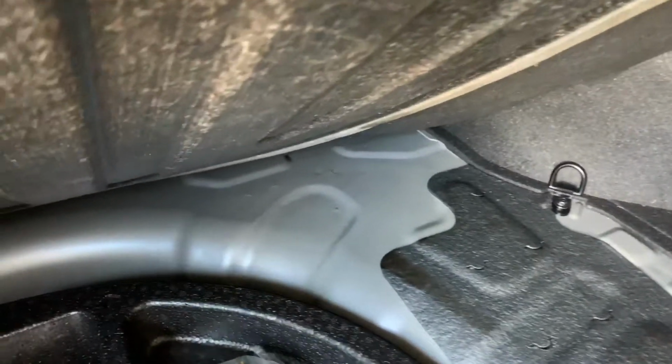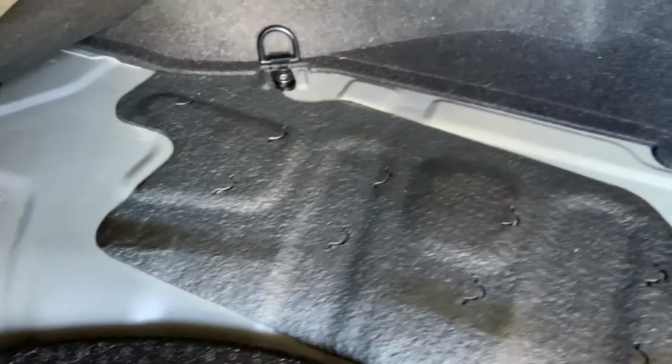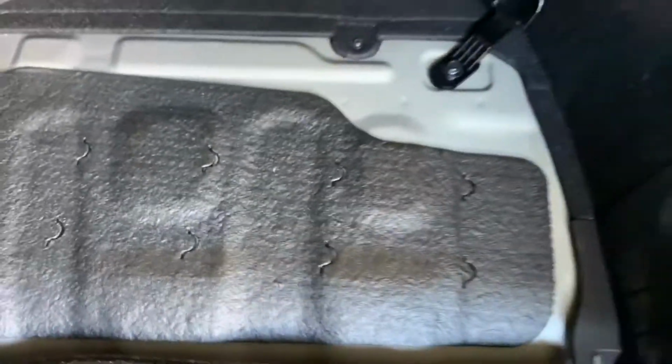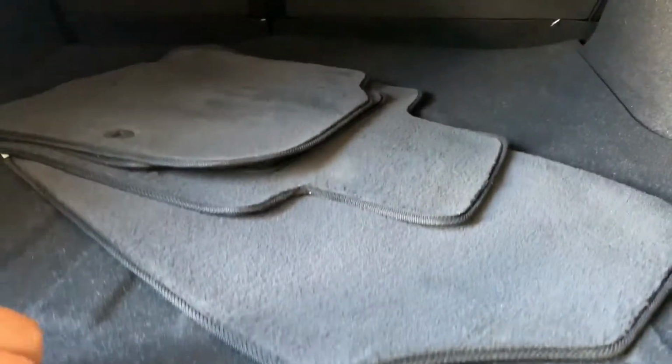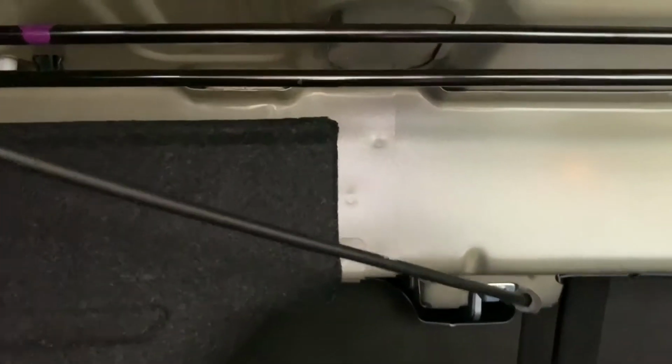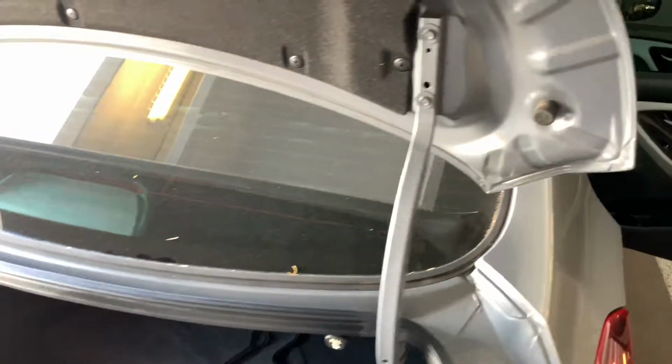Here I'll lift the rear to show you that your trunk floor, or your trunk pan, or your floor pan also has spot welds on it, and you can tell sometimes if it's missing on one side. Sometimes they'll be covered up with factory rubbers like this. Doesn't mean that it's been replaced or anything like that. But that just shows that the car's still good. Here I'm showing you the rear brace. It's really rare to see any kind of damage on there, unless it's been hit really hard in the rear or something. Then it can buckle.